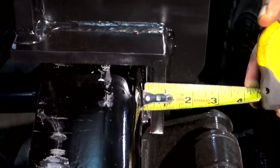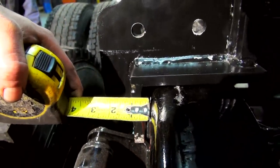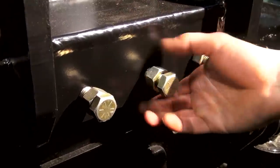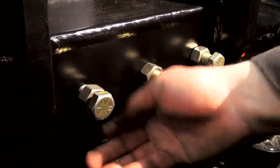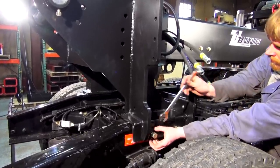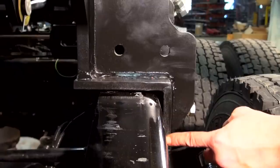We'll position the fifth wheel beam so it's centered on the tail of your truck. We measure the gap on the rear feet and split the difference. You'll find three bolt holes on the rear of the RTU feet, located on the passenger and driver's side. Run these in just until they're snug — this is just to keep the RTU from walking side to side. Once they're snug, you'll set the jam nuts and tighten them, noting that your reveal is equal.